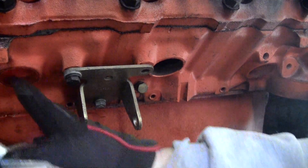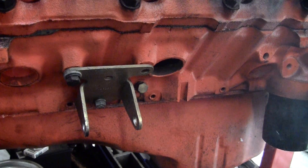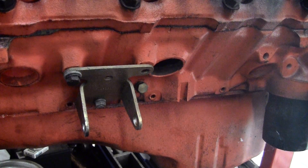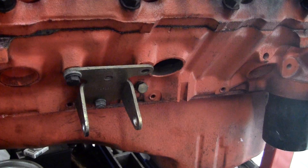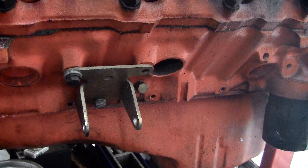I don't think I'm going to have to change out all the others. I wanted to get the transmission separate from the engine to make sure the freeze plugs on the back of the motor were all intact, which they seem to be. So it looks like I only have one on this side and one on the other side - I'll get those replaced, and then we'll get all these top end gaskets replaced in the future, not today. That should be it, then we'll slap it back in.